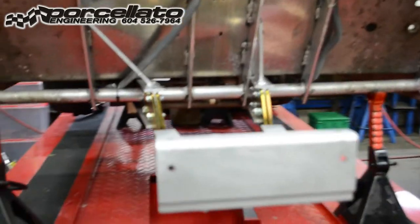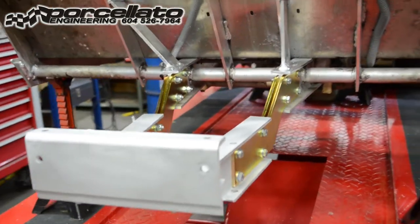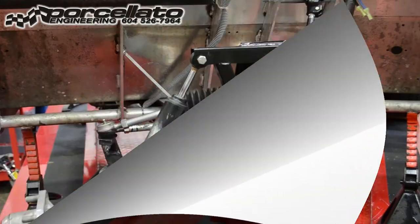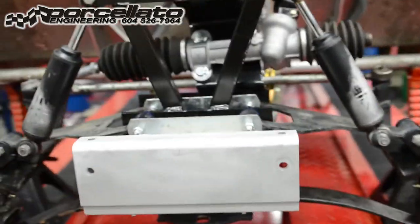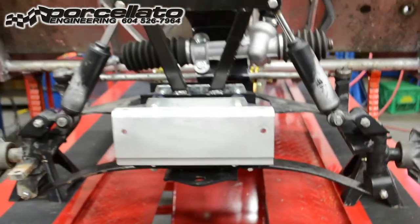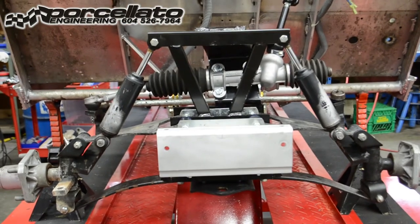If we go beyond this to a 6-inch lift, we're going to use an A-arm style lift — that is the superlative way to go there. We're just going to continue on with the front-end assembly. We've got the front-end components installed and that extended intermediate shaft that we mentioned. Aside from doing a final alignment when it's back on its feet, we're complete up here. We're just going to move around to the back now.